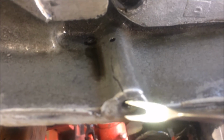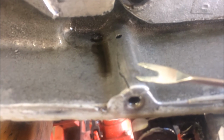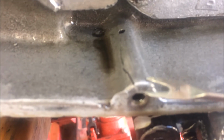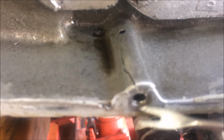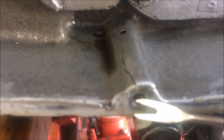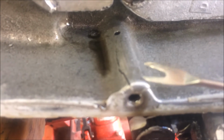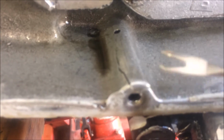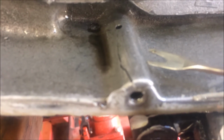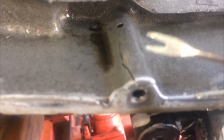this hole is worthless. And this piece is going to come off and get caught up in my primary and jack things up. But this problem is caused from getting sealant, silicone, or what have you down in there. It's a problem, so you got to watch that. You don't think about something like that, but here's the proof that you get enough silicone in there or sealant, and you screw in your screws, it'll build up pressure and crack your case. And this crack could propagate further in. So something to watch.